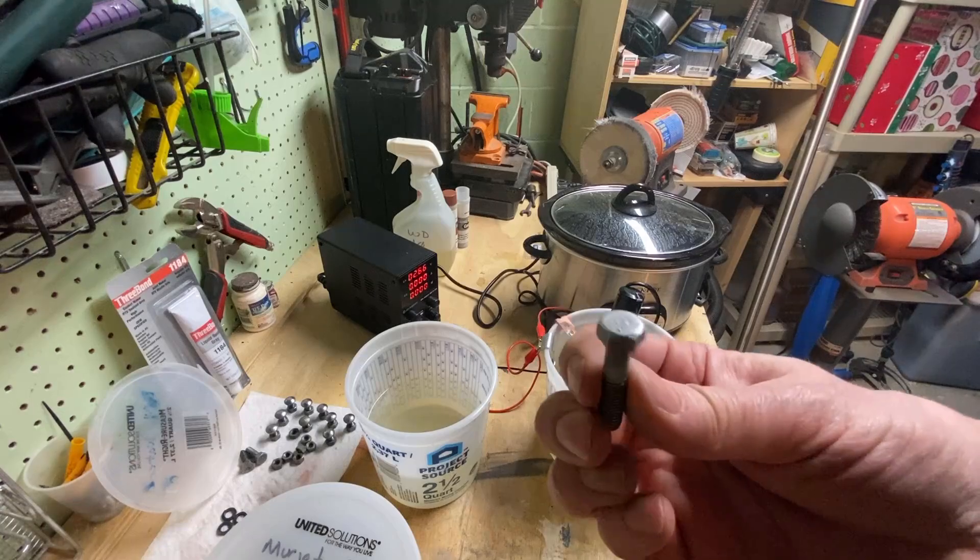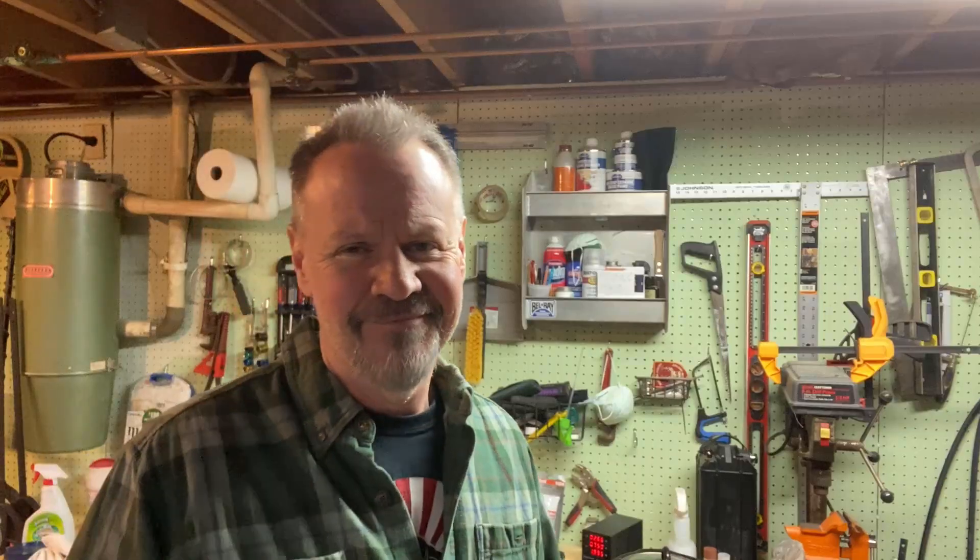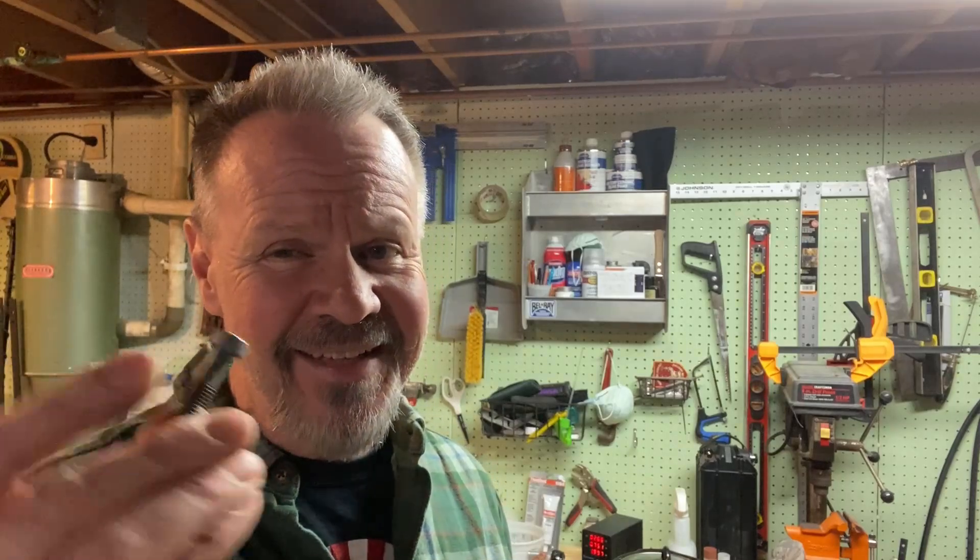There we have it. A little bit of metal polish on a rag and your bolt looks pretty decent. This is a bolt that goes on the undercarriage of an old Honda three-wheeler that I'm restoring — you're never going to see it, I just want it to be protected. Can you get better results? Yes — do a better job cleaning the bolt to begin with, really polish it, use tighter connections, and if you want it bright you've got to get better chemicals. But for a five-minute DIY, I want this thing back together and not rusting, and this is going to do the trick. Thanks for watching — leave me comments if you have any questions.